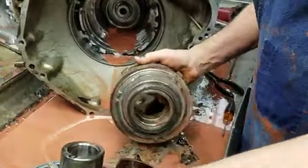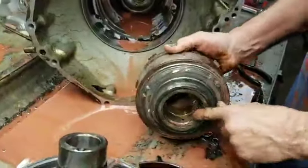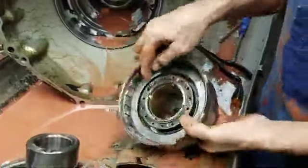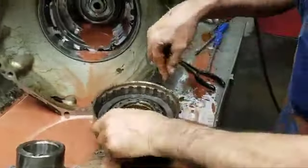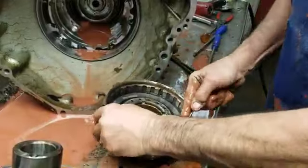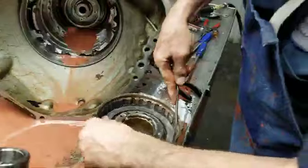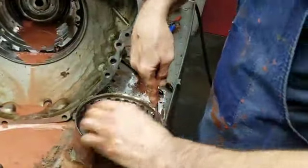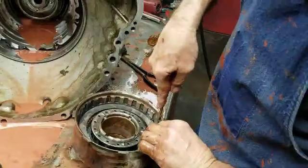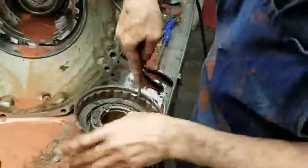See your third gear — this sits on here like that, and that fluid comes out of that hole and goes to this hole, and that's what brings on this clutch right here. Now this here is your third gear clutch. This has the same concept — you can add more clutches to this drum too if you get the right parts.